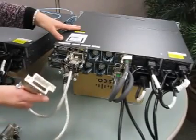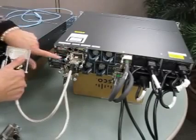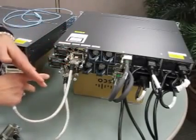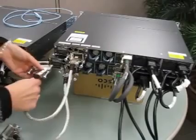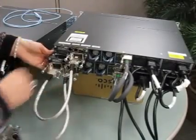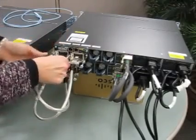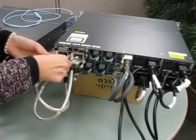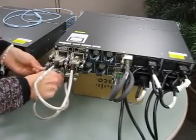The next step is to actually install the switch stacking cables and bring your stack together. If you look at the back of your cable, it is a formed outline that's drawn out on the back of your switch. Both of your current stack cables are plugged into port 2. So we want to create a crisscross in the back for a full bus scenario. We're going to go from port 2 to port 1, port 2 to port 1. So let's just plug those in and secure them. Make sure you do both sides equally at the same time. Otherwise, you'll create a scenario where your interface is not seated properly. Just screw those in nice and snug.